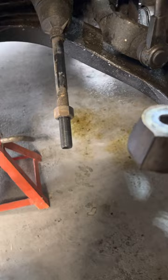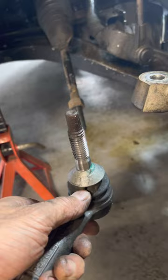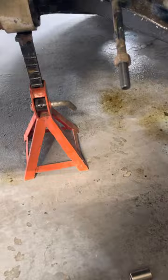I'm gonna remove this right here and install the new one. This one, by the way, had a lot of play in it. So if your Lincoln is pulling down the road and the steering feels loose or swingy, check this — that's the culprit. The other side was bad too; I've already replaced the other side.